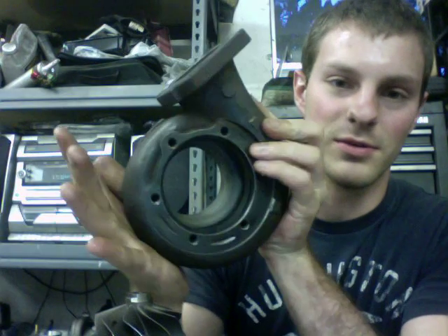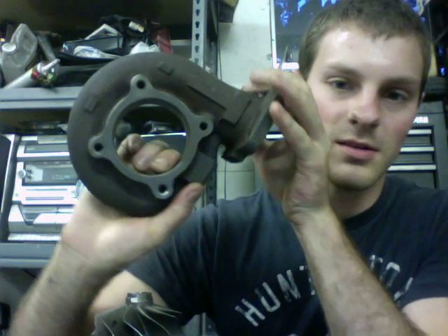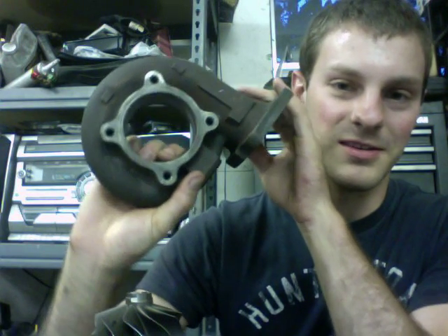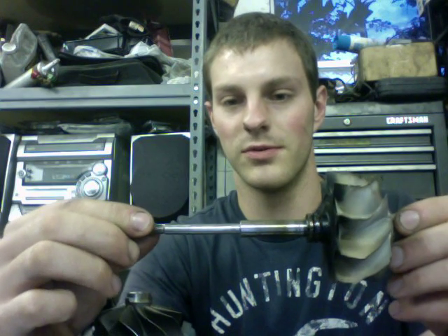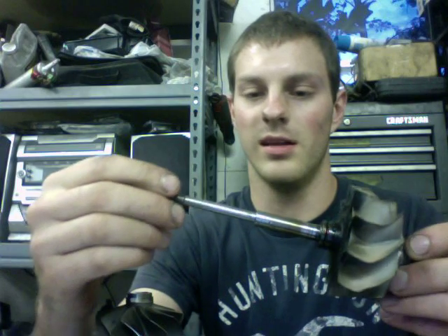Basically this guy just sent that in about last week. And here's the exhaust housing for it — it's a .63 and you can kind of tell it's a little fake looking. Somebody sent that in and it had this center section which takes journal bearings. So it wasn't even a ball bearing turbo, but it was like a counterfeit one. And then they shortened the shaft and it had T04 or T04E bearings, but it had a thrust bearing for like a T25. So it's pretty much garbage.